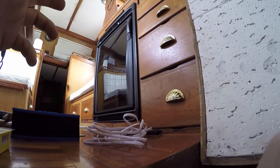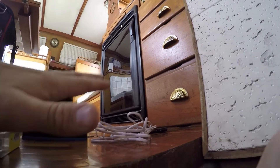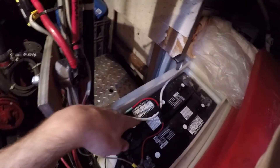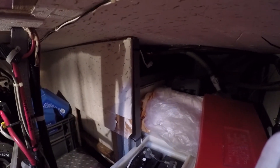That line runs through the decks — I can't get to it. It comes out in an outlet behind the drawers, and you patch from the outlet to the fridge. It's like a two and a half volt or more voltage drop, and this fridge is very unhappy when it gets below 12 volts. So even with the bank fully charged, the fridge cycles on and off in a low-voltage condition. To solve that, I ran a new 12 or 14 gauge line with an inline fuse — about a three-foot run. I fished the fridge cord down through the deck so it's right there. No noticeable voltage drop now, that solved it.